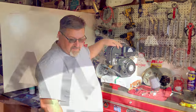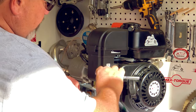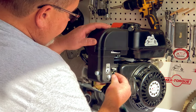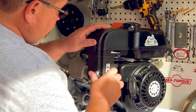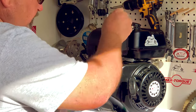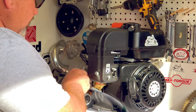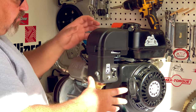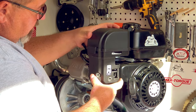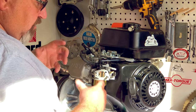So let's get this started. First thing I'm going to do is remove this stock air box. You'll find if you move your levers towards the back, this will all come off easy. I've already clipped the vent hose up top and removed the hose off the valve cover, but you will need to do that. This box will just pull right off once those two hoses are removed.